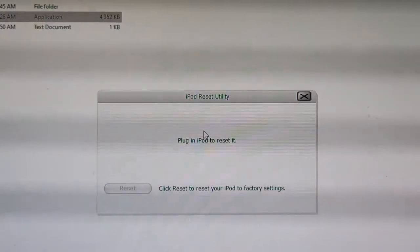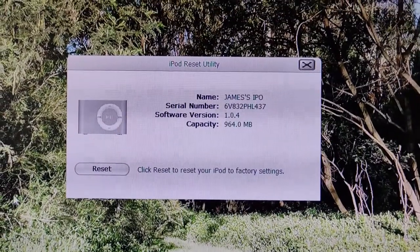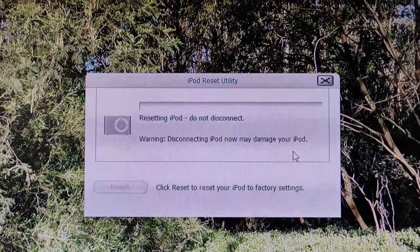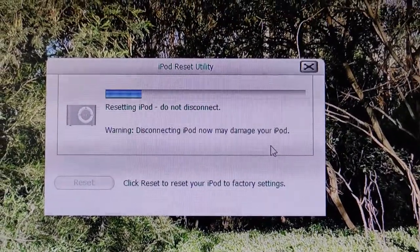If you're having trouble with iTunes, there is a dedicated iPod reset utility for this model. I'll put a link to it in the description. Sometimes iTunes won't detect it, or it'll say it's corrupted and won't let you fix it through iTunes. A lot of the other iPods have a recovery mode in iTunes when you plug them in and they're faulty, but this one has its own dedicated tool.